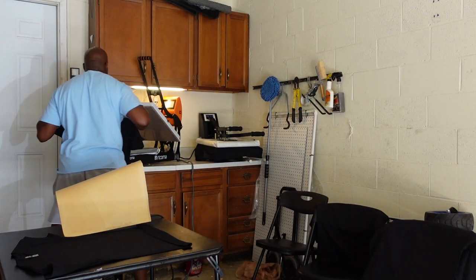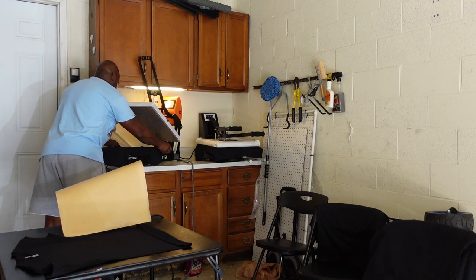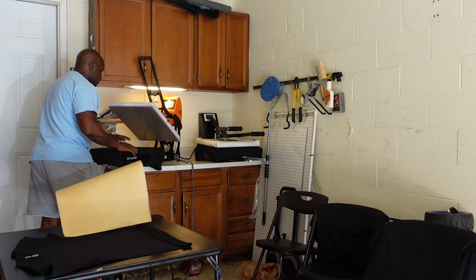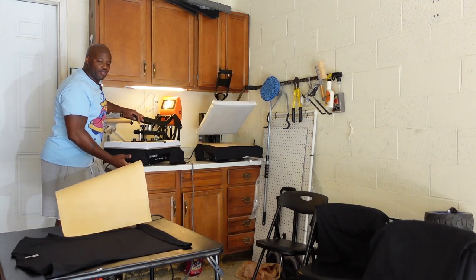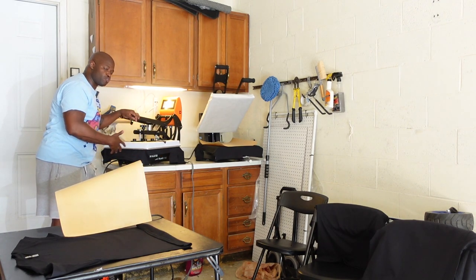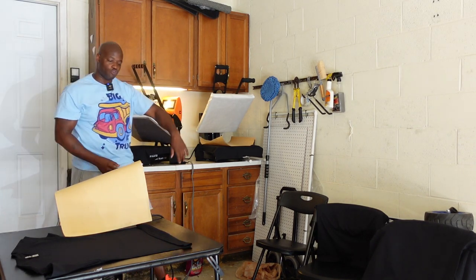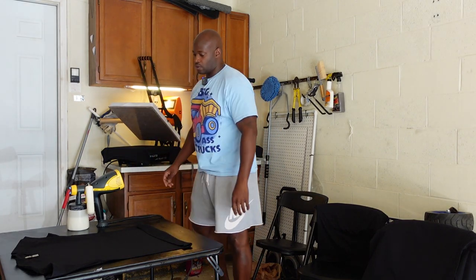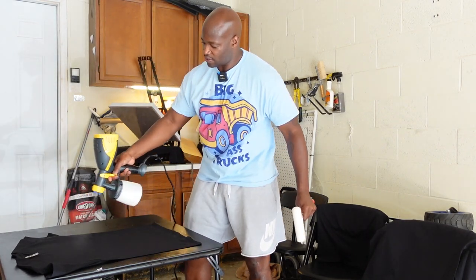Real life story, I'm gonna tell you what happened to me. All winter long, I was printing on my DTG printer, but I found that every couple prints, the image would get messed up because the inks were doing something weird. I think the room was too cold. I have my humidifier and proper settings to keep the humidity up in the room, but the fact still remains that the DTG printer performs best in warm environments. The printer needs to be warm, all right? I didn't spray this yet.